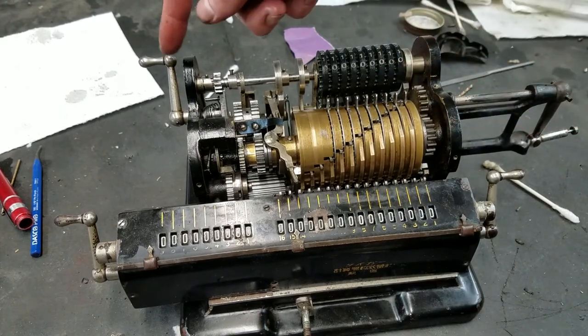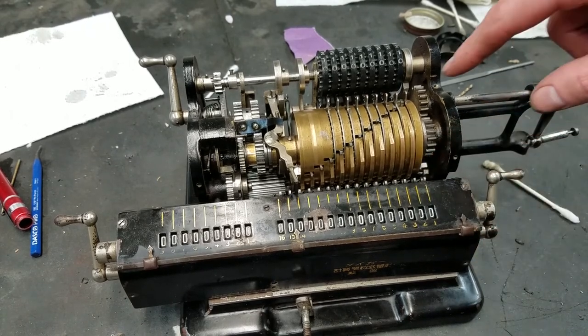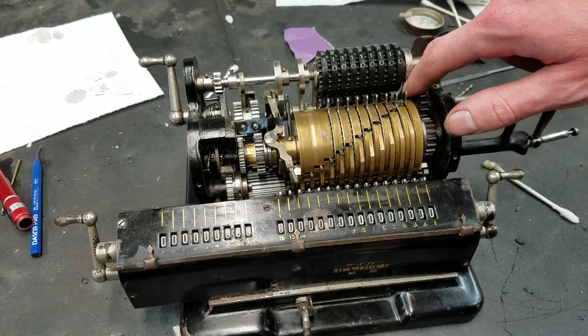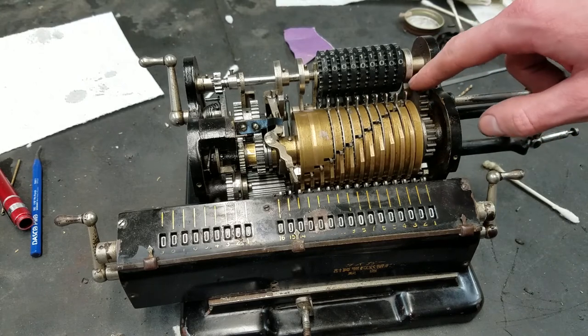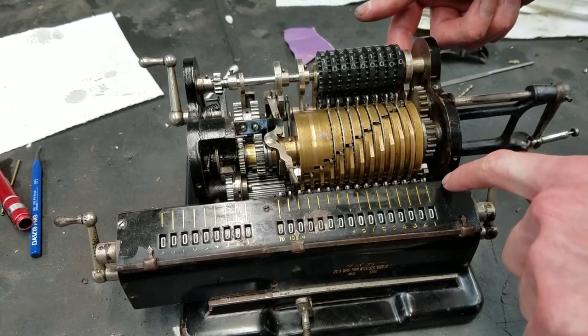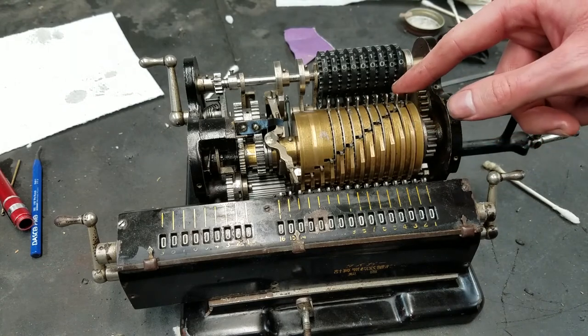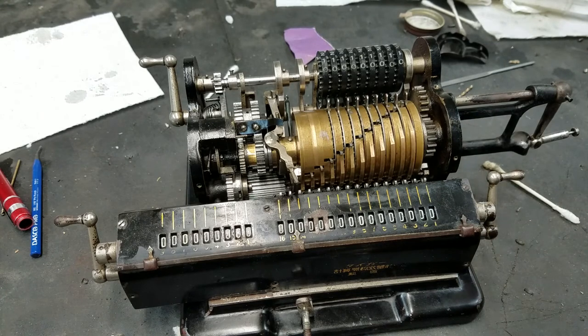And this is a little bit stiff on the crank handle because you're pushing these in and there's all that spring tension on. So basically how this works is, you can see there's these two little cams here with those little fingers that ride on them. Right now, the fingers are in a divot on the cam, and when the shaft rotates, the cam pushes that out, and when it does that, you can see this piece down here moving, that will push in, and that pushes that bar in to release the detents on all the input fingers. Because there's so much spring tension on that, which, again, maybe because I didn't use the right springs, not really sure, it's a little bit stiff on this crank, but clears out just fine, and it seems to release the detents fine. So I'm not really going to worry about it. I think it'll be okay.